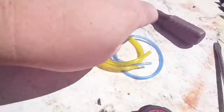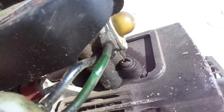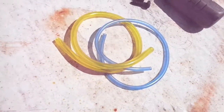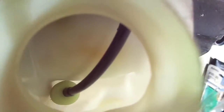Alright folks, I am back. I had these two little screws — one here and one here — and I took this tank off. The only thing I got to do is take those two hoses right there off. I'm going to attempt that with the needle nose. There are new fuel lines here that might work, but that doesn't look quite the right size. I might have to use this yellow one and cut it in half — it goes down in there pretty far.